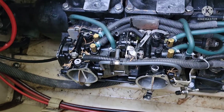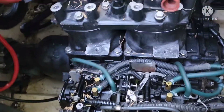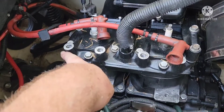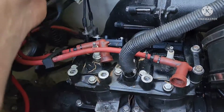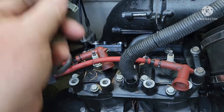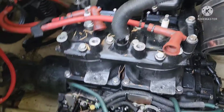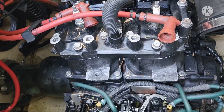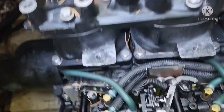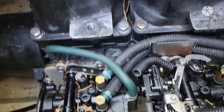So when I've built one, what I do is only attach my two 12 millimeter bolts and my rubber boots. You can just shove your temp sensor in — put some grease or something on it so that it releases. That's the way I do it until I get the carb running right, and then I'll bolt everything down, because it's kind of a pain to get everything out. A Kawasaki is much easier to pull — you can do it in 10 or 15 minutes once you get good at it.